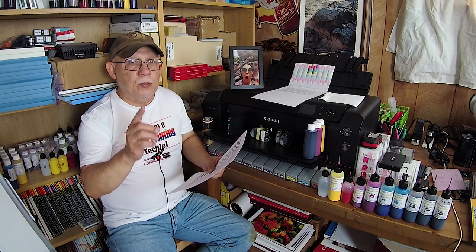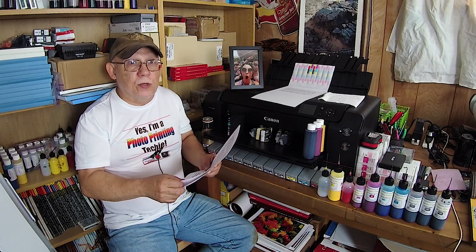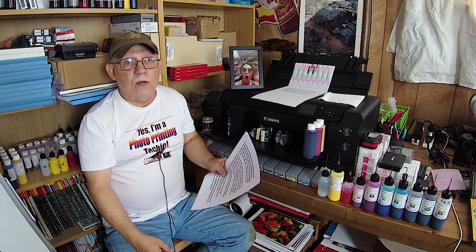But here's the big problem — here's why I'm doing this video. What if you do that on the Pro 1, the Pro 1000, the P800, P600, 3880, or 3800? Those printers have stationary cartridges. Do you realize how much ink it takes before you even see any change in color rendition? A ton of ink. When you initiate those printers, you realize your ink drops to 50% — that's how much ink has to pass through. And it's not like a clean wall either; it all starts to intermix. It takes forever. It is a total nightmare to have to re-flush a Pro 1, and an even bigger nightmare for the P800 and the others.